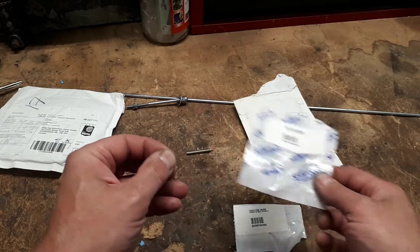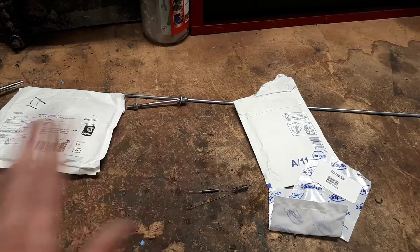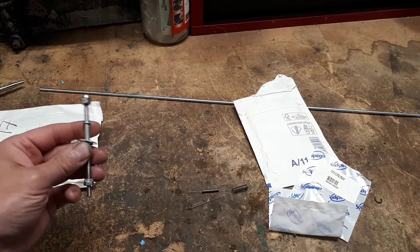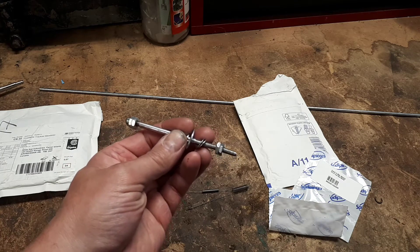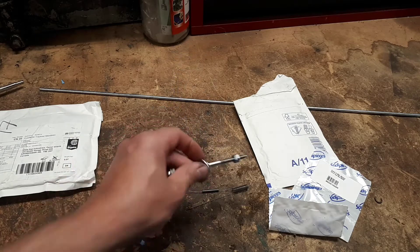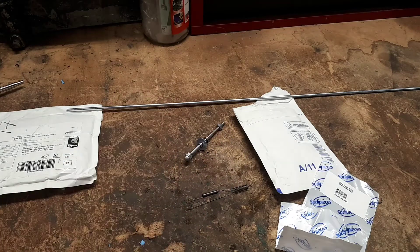Come on out of there - there we are. That is the governor link spring for Goldie Hawn, and this is the throttle spring they call it. So we'll be able to get that all buttoned up tonight. That'll be the last parts for the governor and we can get it running properly. I also had a heck of a time finding something in a 10-32 thread by four inches. I determined that this piece of 3/16th rod, three feet long for five dollars, worked, and I made this - I'll show you what that's for in a little bit.